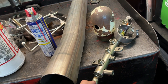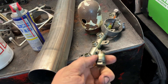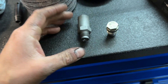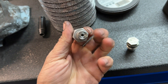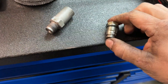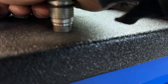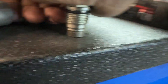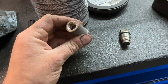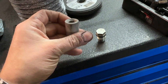These are pressure relief valves — PRVs. What happens is when the rail pressure gets too high, it will actually push this down and return fuel out of the rail. Here are the two versions: this is your 5.9 relief valve — you can see it has a hole — and there's a check valve inside. On your 6.7, I was actually able to get this one to move a little bit. Basically the fuel pressure moves it and unseats it. Those are your two differences. I'm pretty sure these cross over to Duramaxes as well.